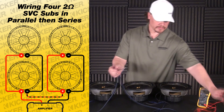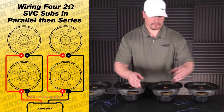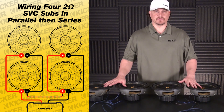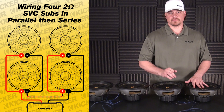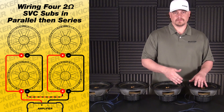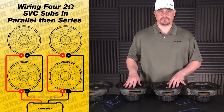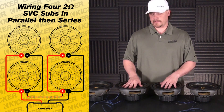So all my connections are good. I'm ready to finish it out and put it together. Also, if your box has any kind of dividers separating chambers or anything like that, it's fine to drill a really small hole to run these jumper wires through to get them out to your amplifier. You can silicone the holes shut if you want — it's not going to hurt anything.